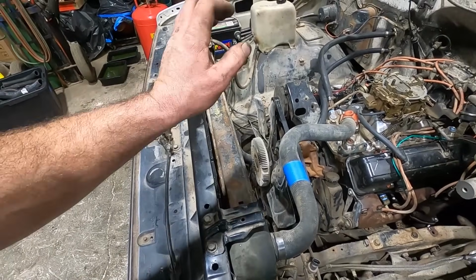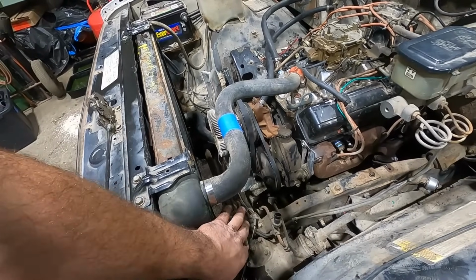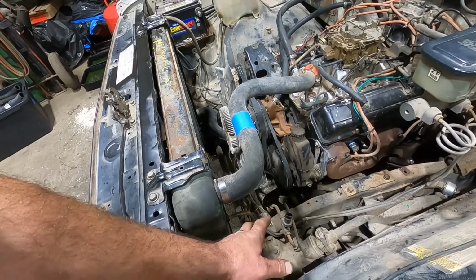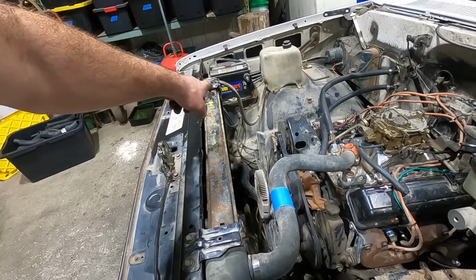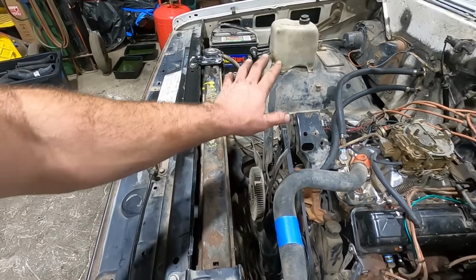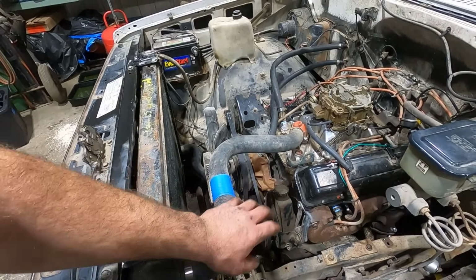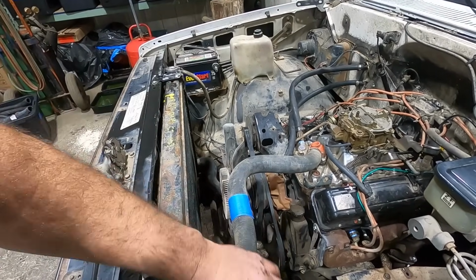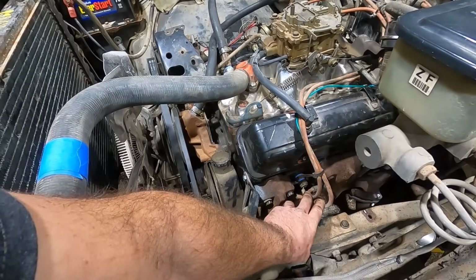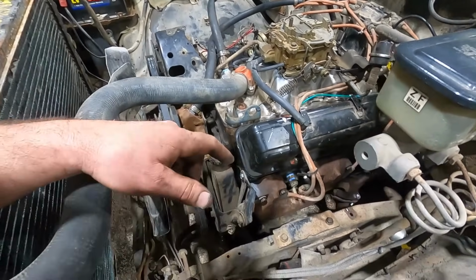What we got? We got the radiator of that 5.7 diesel. Use the tranny lines off of that because that had a turbo 400. They come over on the driver's side on the diesels apparently because there's an engine oil cooler on that side. Grabbed a little bit better fan out of my stash. All the front pulleys worked out. The power steering pump, we use the water pump, we use the pulleys, alternator brackets, the alternator wiring reached. I did have to extend the wire for this temperature sender and put in a bushing in there.